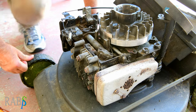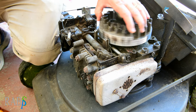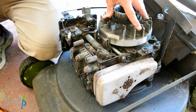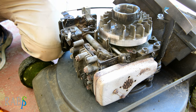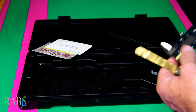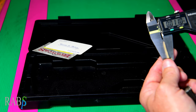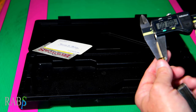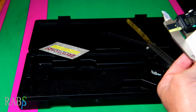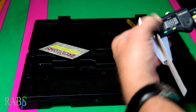This flywheel has magnets on one side and just weights on the opposite side to keep the rotor in balance. I've put the magnets to this side in preparation for putting on the coil. The specification is 0.010 inch — that's a feeler gauge. For those in metric countries, 0.010 inch is 0.25 millimeters — a quarter of a millimeter.